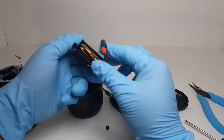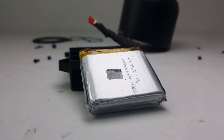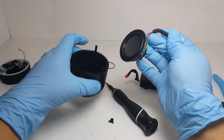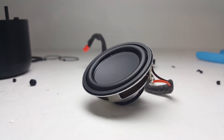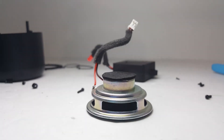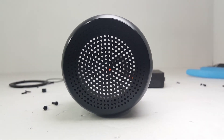The 1800mAh battery was nicely stuffed inside the battery compartment and taking it out did take some force, but I eventually was able to get it out. Once the battery is out, the driver just comes out like so. According to Anker, this small driver has an output of 6W, which is not too bad for its size. Here we have the speaker enclosure and it looks like it is made of aluminum, so it should be durable and able to withstand drops and many years of abuse.